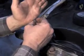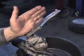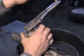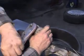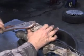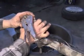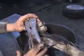You put your vice grips on here at 12 o'clock from you so that you'll know that as a reference point. Now that you got your vice grips on there at 12 o'clock, you're going to turn this thing counterclockwise until it hits the end of its travel. So you count your clocks. You got half a turn, 1 turn, and as you see, we're spilling fluid over here, 1.5, and back around to about 5 o'clock. So I'm going to write that down.